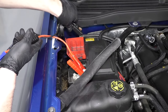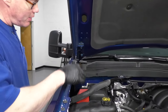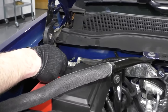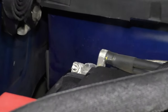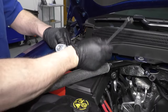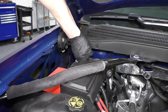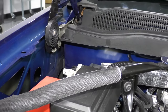You can attach your negative cable right to the negative battery cable here. If you want to do some electrical work on your car and need to disconnect the battery, you want to disconnect the negative cable. You can use a 10 millimeter wrench and loosen this 10 millimeter nut — better tool is a 10 millimeter socket with an extension and a ratchet. Loosen that up, then pull the negative cable, twist it a little bit, pull it up and off and to the side.